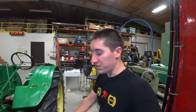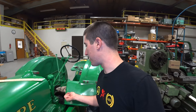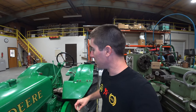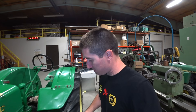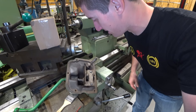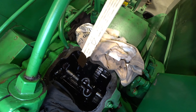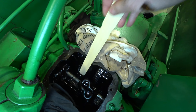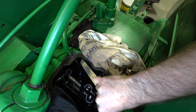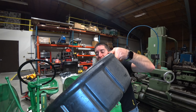So the first pan of diesel is out. What I'm gonna do is put the plug back in and strain that through my fingers to keep the sludge out. I want to put the diesel back in the crankcase — quite a bit of it — and then use this paint stirring stick to stir up the sludge that's left and get it all cleaned out. We think the oil in there was 40 or 50 years old. You could tell from how the gear selector case looked that it was nasty and covered in sludge. I poured it from one pan into another to get the sludge out — most of the sludge settled to the bottom of the other pan. It's working pretty well.